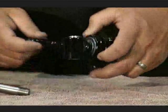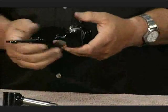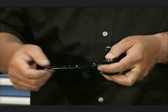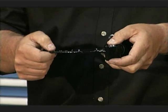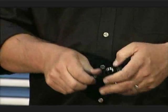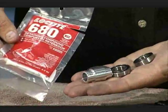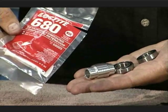A good way to tell if your spindles are in need of repair is when they're bolted on the cart through the kingpin bolt: grab your spindle arm, and if you can move it up and down — if you can feel loose play up and down — chances are you need to rebuild your spindles. We sell a rebuild kit, and what comes in the kit are two bearings, an inner sleeve, a snap ring, and some retaining compound.